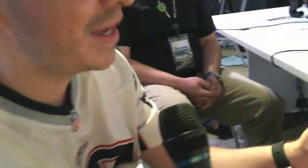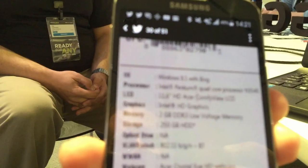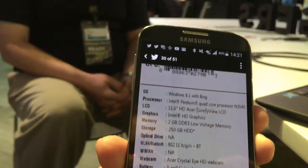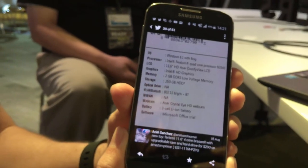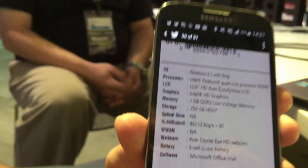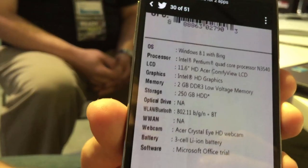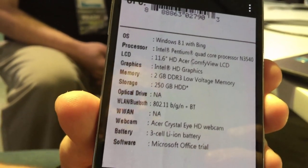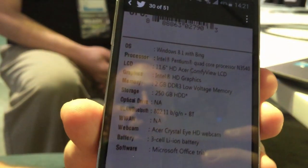You can see these are the specs on this machine as bought. The only things I've done is swap out the hard drive for an SSD, and I upgraded the one DIMM slot — it came with two gigs, and I had a 4GB DDR3L DIMM lying around. It actually performs really nice.